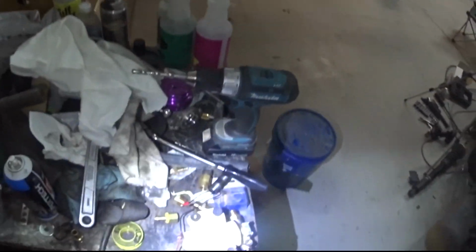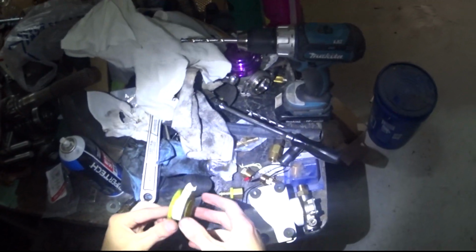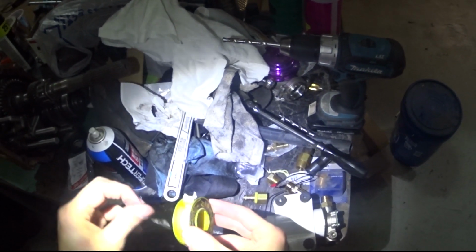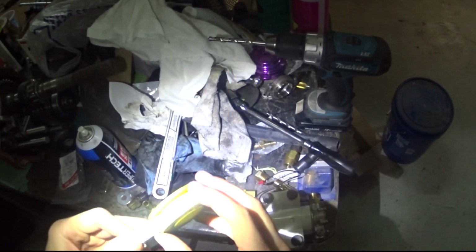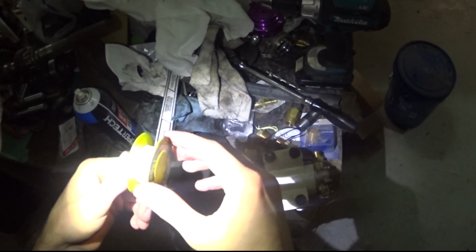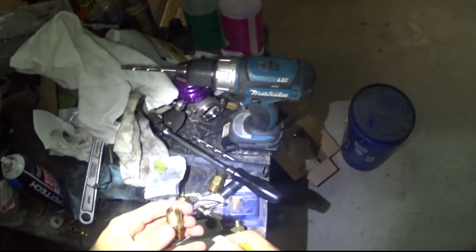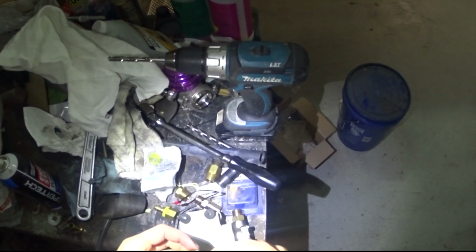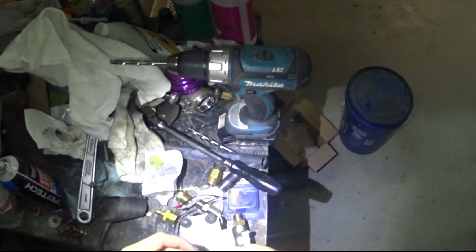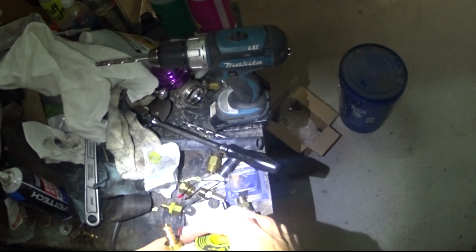Alright, so I'm getting ready to put a few of these fittings on over here. This is a different type of thread tape. This is some oil resistant type of stuff that David got all dirty. What's up with this? It's coming apart all shitty. David! It was worse when I used it. So when you put on thread tape, there's actually a way you're supposed to do it. You're supposed to go so that at the end there's not an exposed flap, so you gotta put it on the right way. It takes me a second of thinking about it every time I do it.